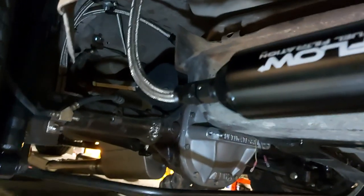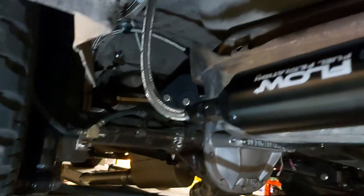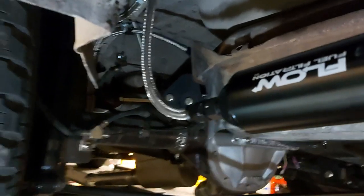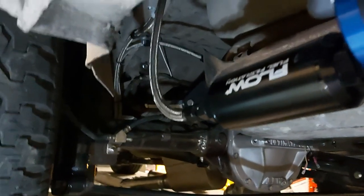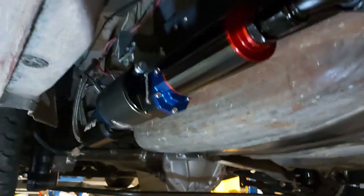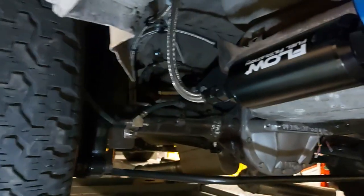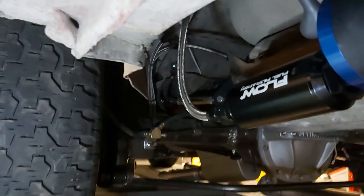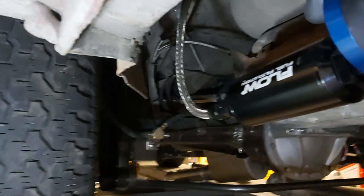The number 6 PTFE line is actually 0.350", so we're fine going number 6 to our fuel rails. I wanted to use factory truck-style fuel rails and the regulator built in, and it's good for boost and vacuum — as the boost goes up it'll increase our fuel pressure one-to-one. I'm just using a factory truck system in Project Turbo LS to see if it'll be enough for 800 horsepower or whatever. My buddy James gave me this PTFE line for free because I helped him with his 2,000 horsepower twin-turbo Jeep Trackhawk.